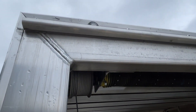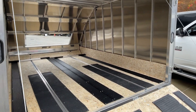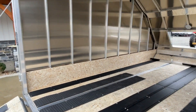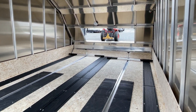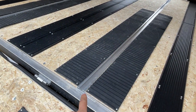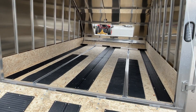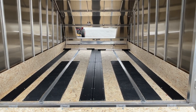You've got your guides and mats on the floor — these are not crooked as it might look; the way the door is done, it tapers in. Pretty slick setup. Here's a close-up of your welds and corners. These corner posts are all tubular aluminum. Corner posts, headers — that's all going to be tubed. Wall posts on these are going to be 16-inch on-center tube. Ceiling is also 16-inch on-center tube. You've got your two sled tie-downs and your mats, plus a full-length tie-down on either side for your sled. It's got a 12-inch perimeter kick plate and engineered weather-resistant, water-resistant flooring.